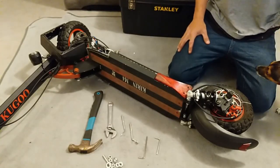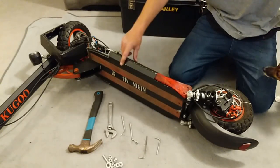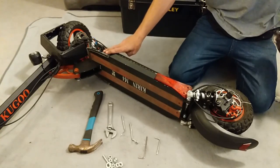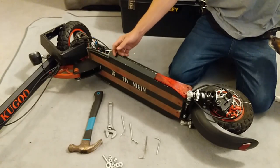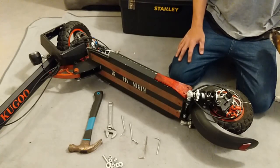The first problems you're going to encounter are all the cables coming from your motor running through the cavity on the side of your scooter. You've got your three main connectors for power and a block of five-pin connector for the hall sensors on the motor, which I'll show you in a minute.